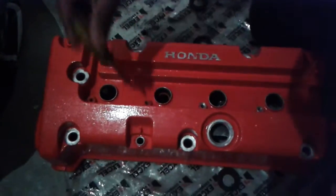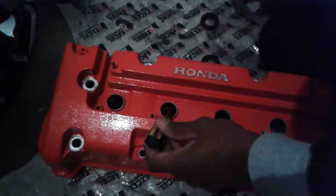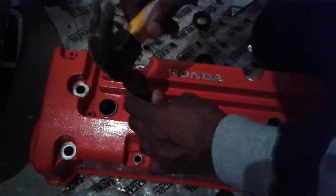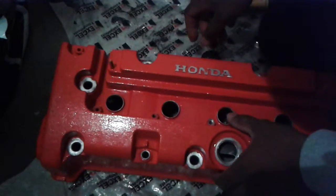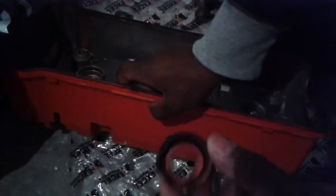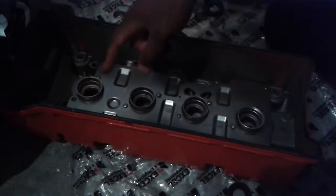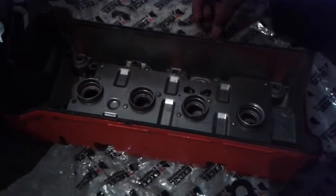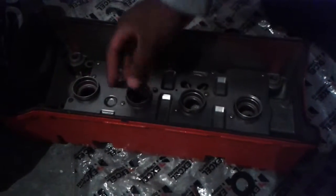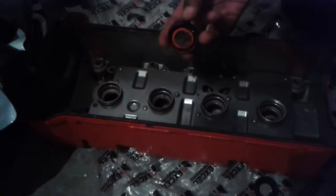The way to do it: find the lip and just tap it all the way around. You need to tap it harder than that. What you'll find is it'll pop out — so that's the old seal there. Now if you look at the back, they've all been done, all these seals have been taken out. I've had to literally get a screwdriver — probably not the best tool to use — and a hammer, and tap these out.